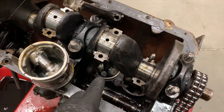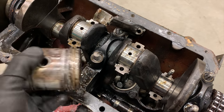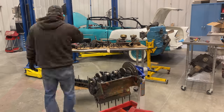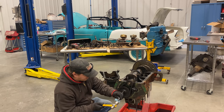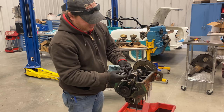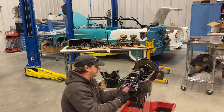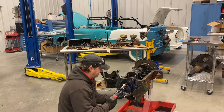It's just too bad that they let all that rust get inside the cylinders, because if it weren't for that I could just throw new bearings, a rod, and a piston in here and it would probably be just fine. But now we have to deal with all the rust in these middle two cylinders. You can see these washers have a hole in them — there's a little pin on this washer that keeps everything from spinning so nothing is loosening.